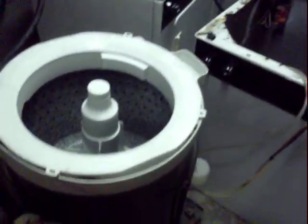This is basically a freestanding chassis washer. My problem is visible here: the front spring of this machine is just weak. It's actually leaning slightly to the right, and when I press on it, it compresses really easily and wants to lean forward. This washer is on a slight incline right now, but it's also empty and should not give that much. Also, someone left a quarter-inch wrench inside the machine, which was kind of funny.